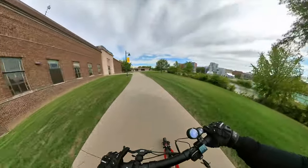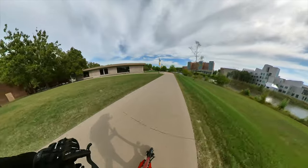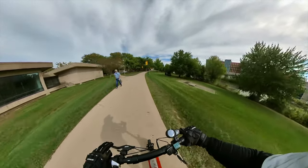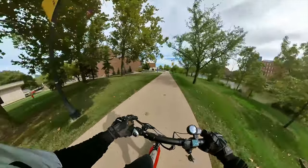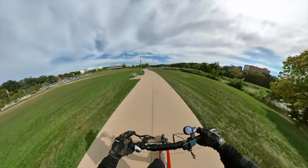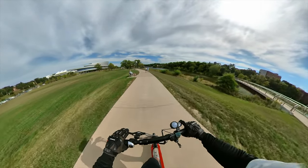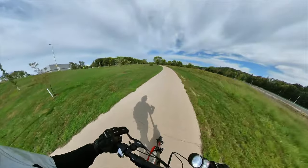The tires — they're eight-inch tires. It's the same as a Xiaomi. The Max has 10-inch tires but no suspension, so the trade-off is eight-inch tires with suspension. Is it better than 10-inch tires with no suspension? The answer is definitely yes — it's a better ride. Even right now there's no handlebar vibrations, no bumps or anything. Overall every one of these little cracks, it's just really smooth comparatively. The front tire is air, the rear is solid, meaning you won't get a flat tire in the rear, which is the most common way to get a flat. That goes back to the low maintenance of this scooter.